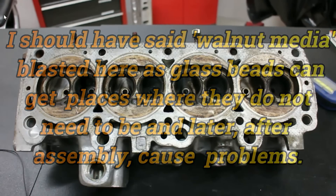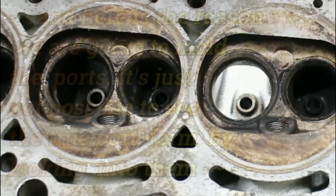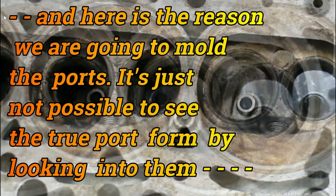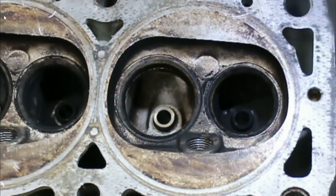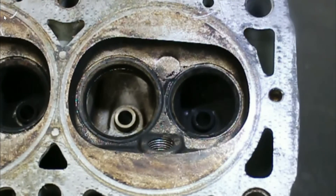Let's have a look at the ports and see what we're starting with. There's our intake port — it looks like it's got some potential. It doesn't look too bad in stock form, except for detailing. Here's our exhaust port — well, it's difficult to see what's going on there because it's a bit black. As I've said before, the combustion chamber — a bathtub chamber — is not the best chamber to have, but we can do things with it. So let's start the ball rolling.